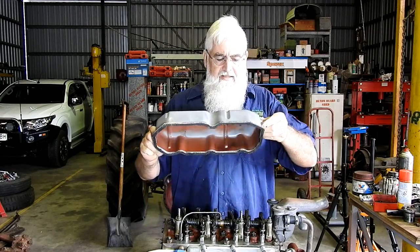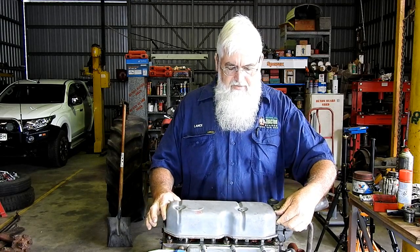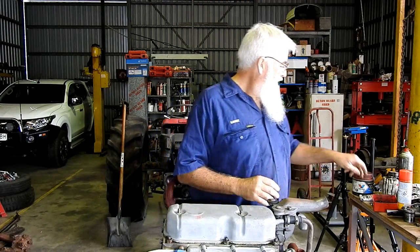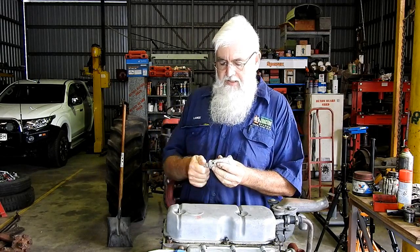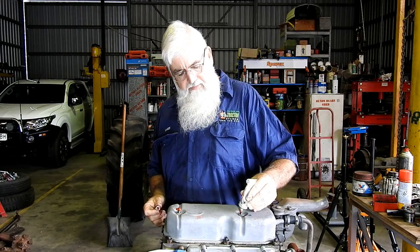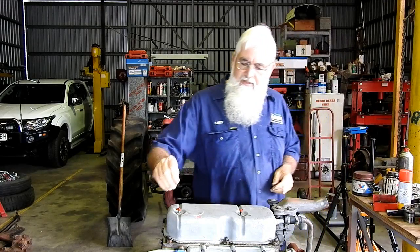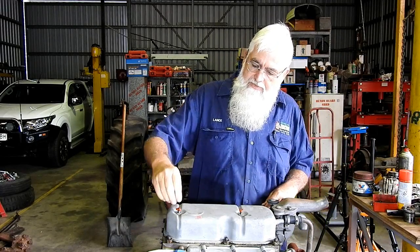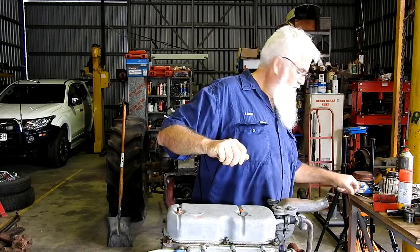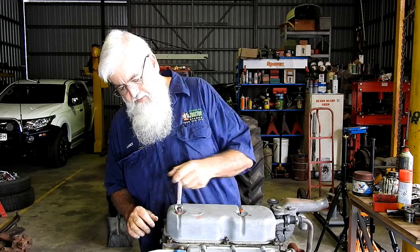Okay, so that tappet cover gasket is stuck on there. We should be able to slide that down and line up the holes. Now I usually just pop a little bit of silicone on here, just a little blob like that and a blob like that. Then there's a flat washer there already too, so then we just wind the bolts down. I've got to find the other bolt yet, it's over there somewhere.